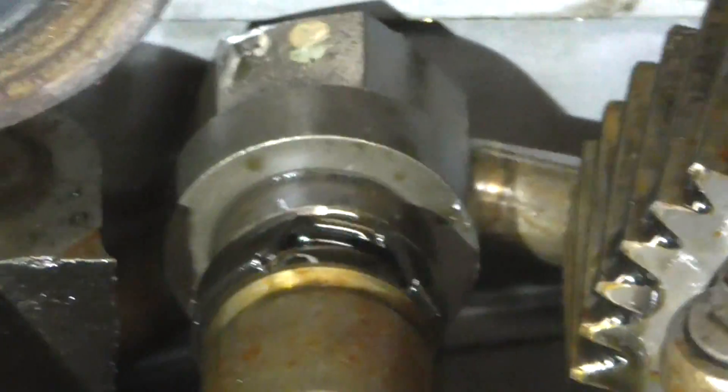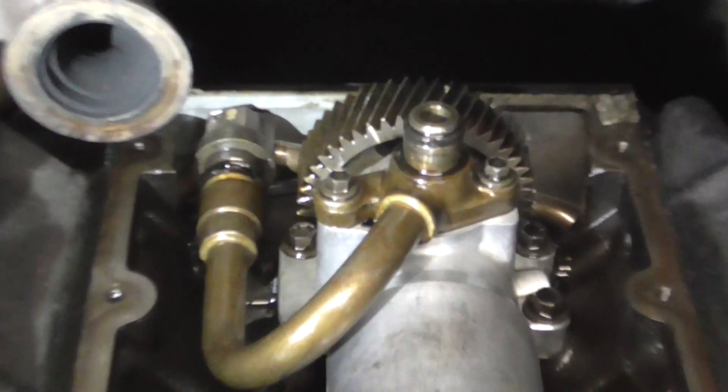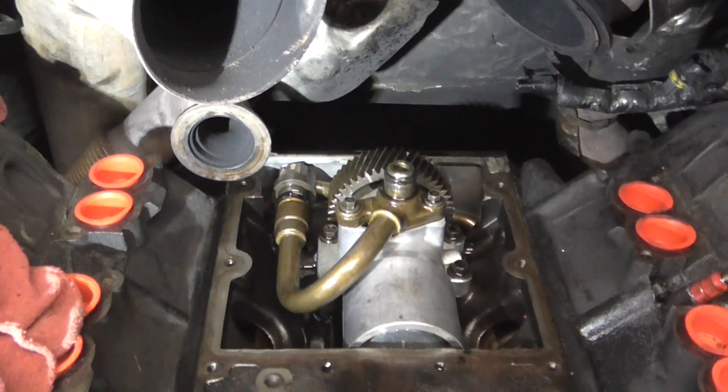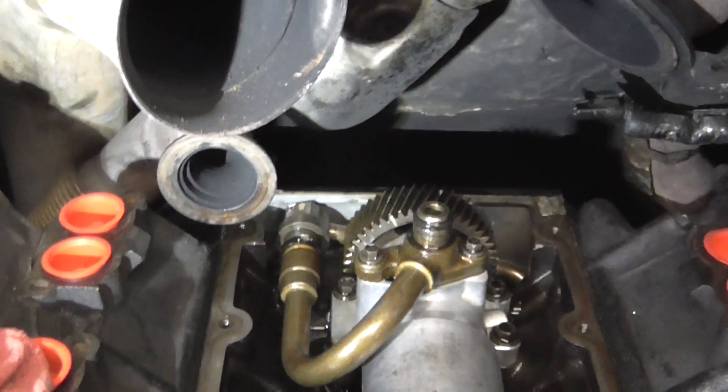Normally you need 500 to 600 psi on your high pressure oil line on these to get the engine to start. Once you're running, idle is usually around 800 or so, and you can go up to about 2500 psi on the high pressure oil line.